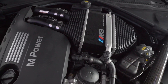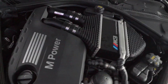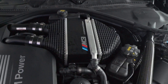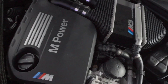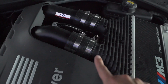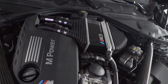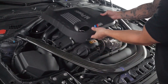This should be a pretty straightforward install, nothing too difficult or tricky. The only thing you have to worry about is the coolant — we're going to have to drain or empty the coolant from the charge cooler. If you have a battery tender and a pump you can do that, or you can do it a more manual way like Tommy El Garage and Brian from Keys Motorsports. We're going to keep it as DIY friendly as possible. Basically, pop up the engine cover, loosen the J pipe side, disconnect the hot side charge pipes, and the OEM charge cooler is held in by a couple of grommets. Make sure your car is cooled down before you start because your coolant will be hot.